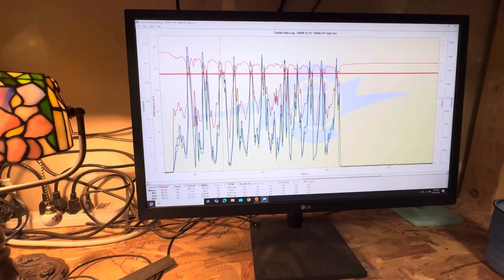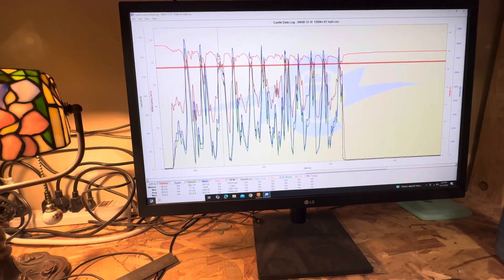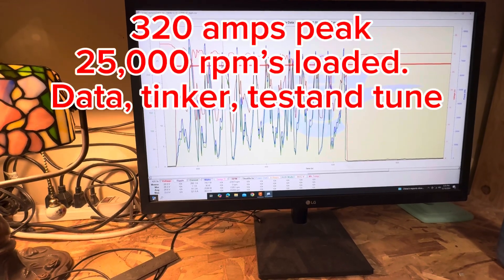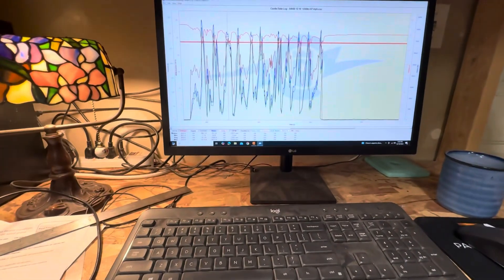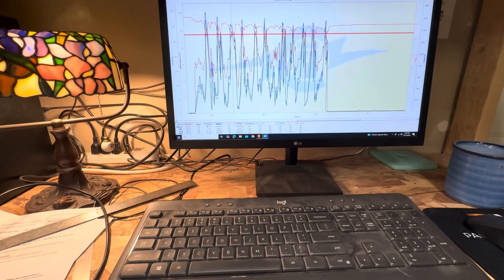Next time around I know I need to make a few changes. I also have my timing at 10 degrees, so I'm going to back the timing off. Something kind of cool — I just found out that motor works well, so we're going to do a little bit of tuning on this, and I've got more coming.